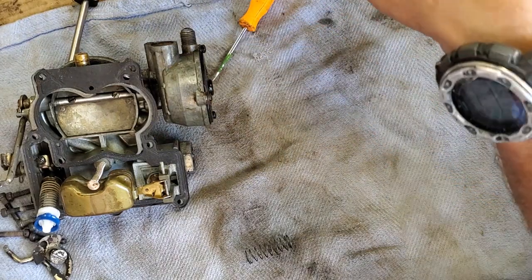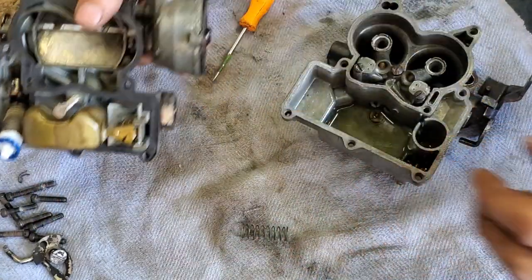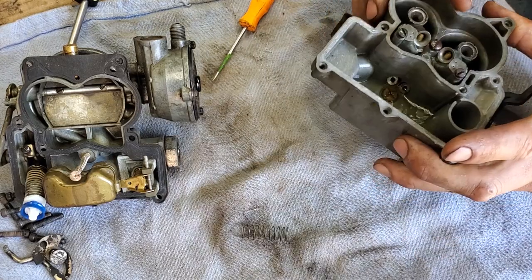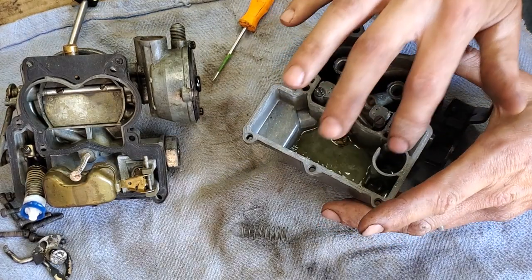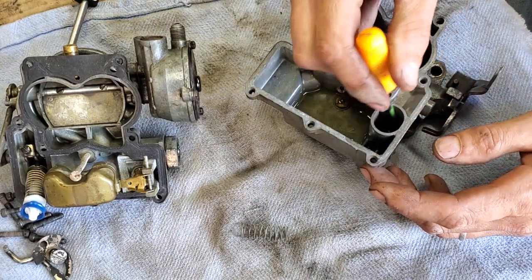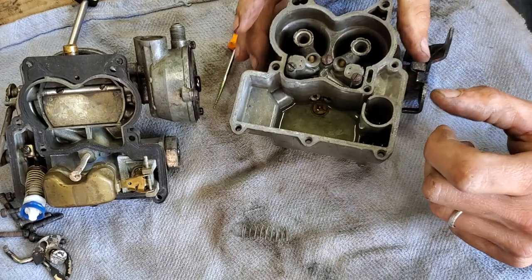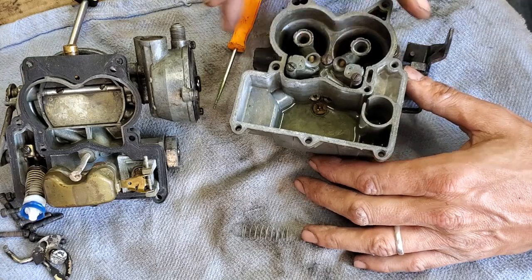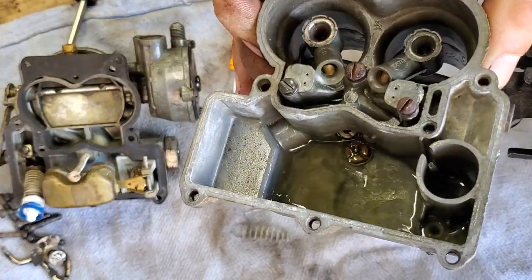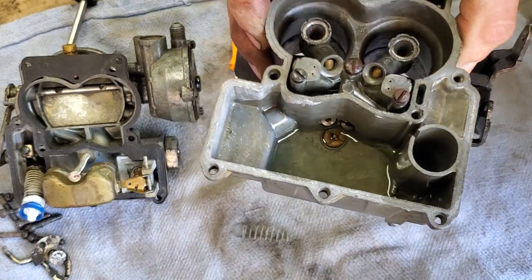What you'll find is there's a little check ball at the bottom of this, and that acts as a one-way valve. When it sucks up, the ball kind of lifts out, and when you go to plunge the accelerator jet, the ball blocks the hole and it travels up the channels and squirts out of the tops over here — that's called your accelerator jet, and that's very important. They tend to get very stuck; sometimes you've got to leave them overnight with PB Blaster and use a fine pointed pick. Sometimes you get a lot of calcification from salt water. You can blow this out with a can of brake cleaner, or use a tiny Dremel brush to clean the entire inside cavity.